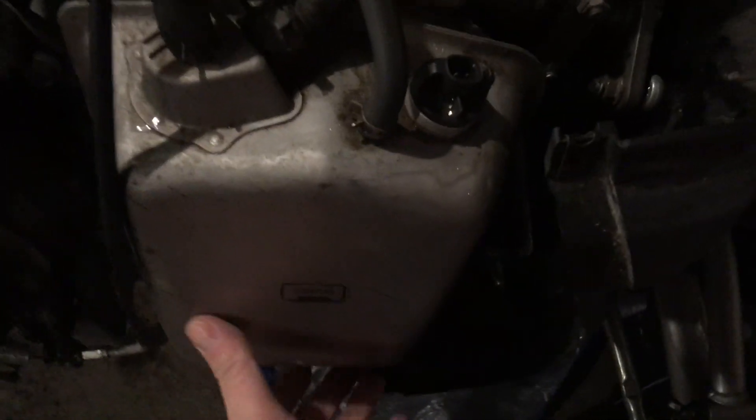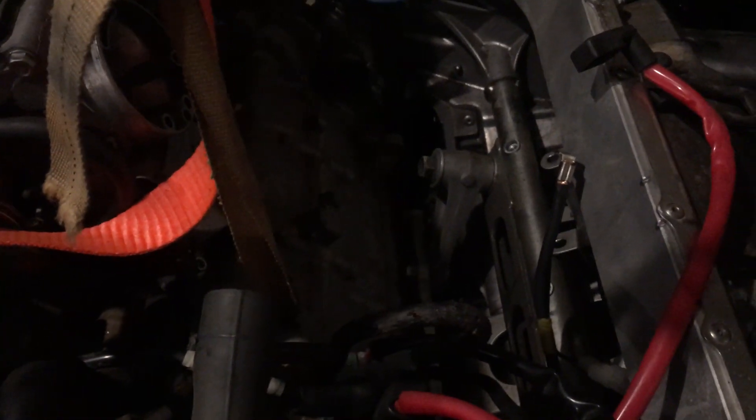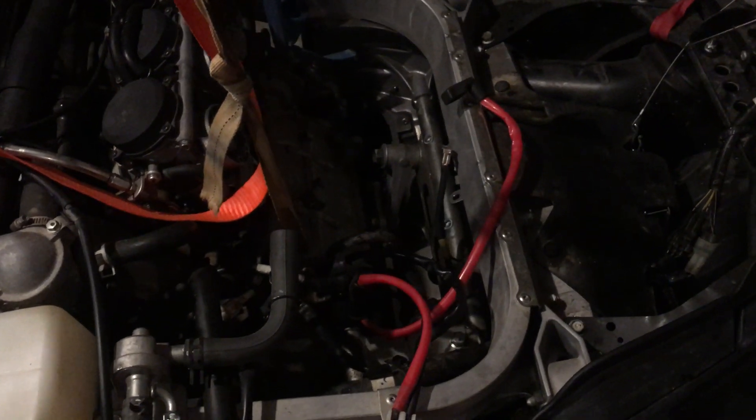There's not much room for it to come out — it needs to come down. The oil reservoir we just let that go and slid it over to the side because there's an engine mount on the back of that. The shop time was like 12-13 hours at the Yamaha dealer — first step being to remove the engine assembly. So this is a much better way. You want her off the ground six or seven inches if you can get underneath it. The aftermarket kick starter is what we got, but the Yamaha OEM one was about $900.